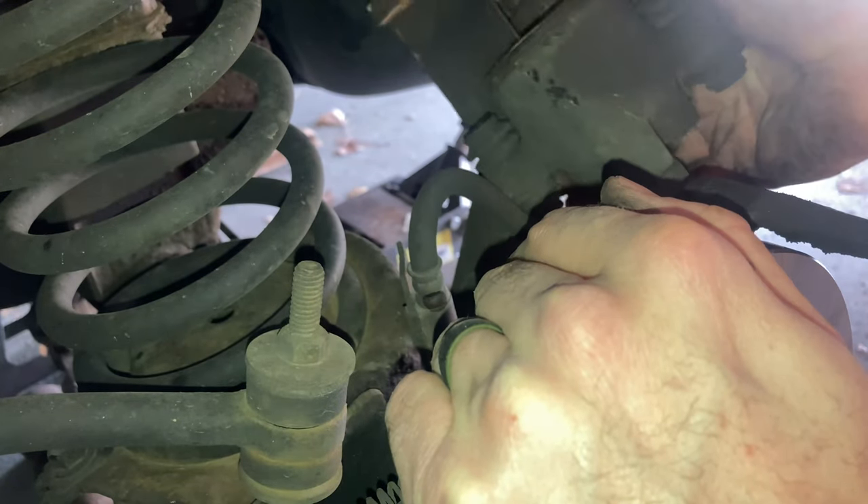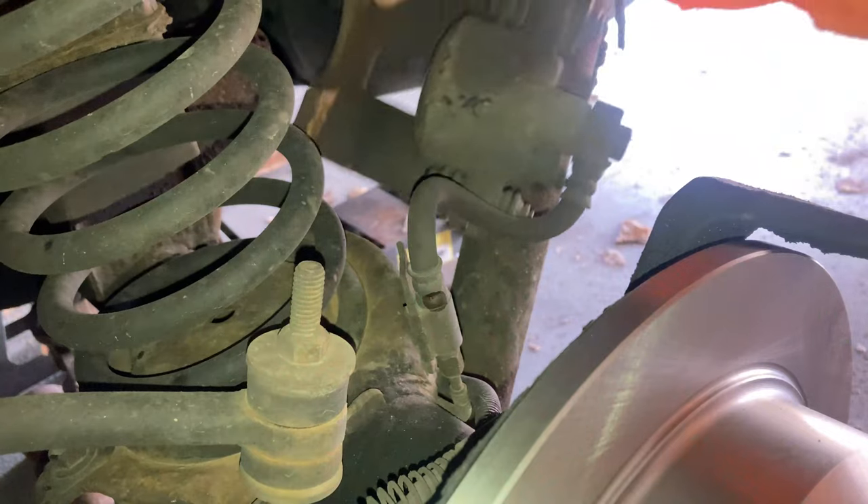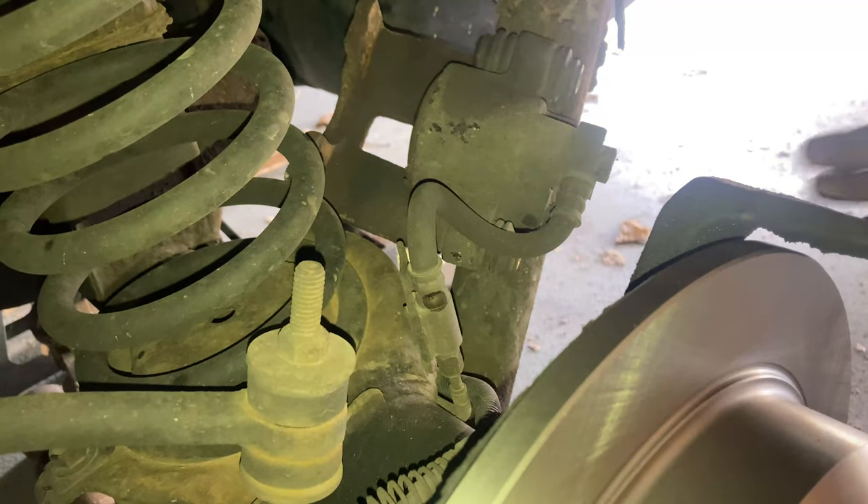Once the piston is compressed, take the C-clamp off and you can put the new brakes on — pretty simple. Thanks honey — that's my wife bringing coffee, she's solid. Get yourself a wife that brings you coffee! So the caliper is set. I'm going to put the new brakes in. You're also welcome to put some lube on the contact points — I actually recommend it. Get some grease — it can be any brand — and put it on everything that's metal-to-metal contact.